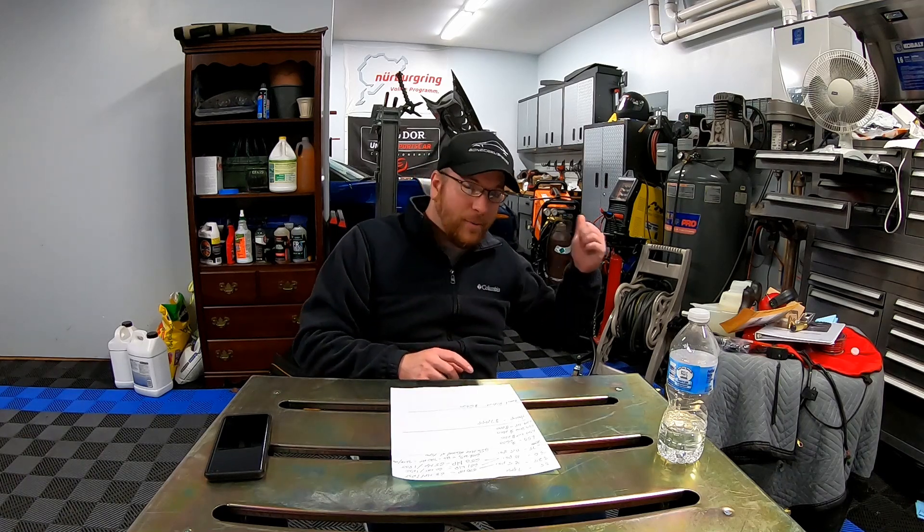One concern with the 2650 is whether you can slow it down enough to work safely on a stock bottom-end LS3 or LS2. I don't know if they make pulleys big enough to limit boost to 11 or 12 psi. With a 3 inch pulley, RPM's Kong blower was pushing 20 to 21 pounds and making over 1,000 horsepower. But the efficiency angle is important — if you slow the blower down, you're making more power with less boost, which is less shock on the drivetrain and you're spinning the blower slower than you would an over-spun 2300 at the same PSI level.